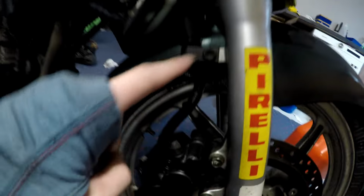Make sure your tyres are pumped up and that they are not covered in fork oil like this one here. That is a big no-no, especially when it gets on things like brakes as well, because it messes with the caliper seals and then your brakes can lock on and you'll be going for a slide.